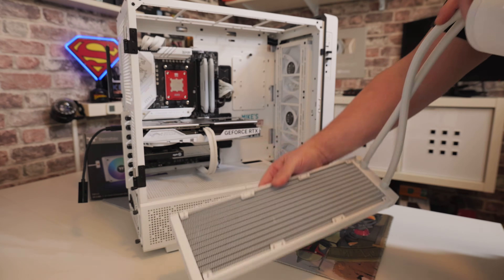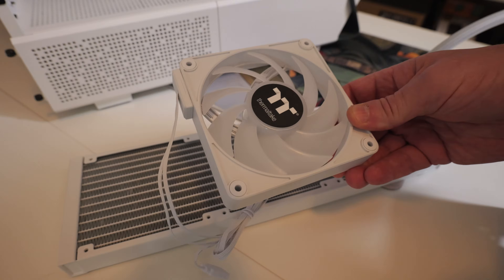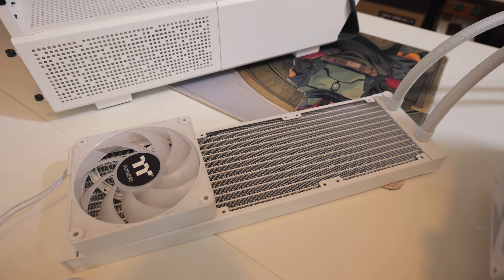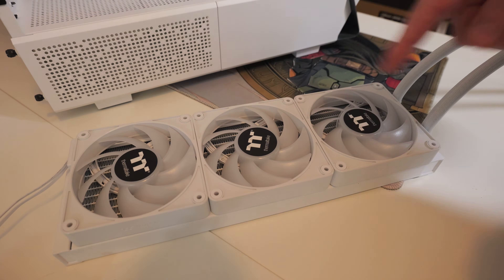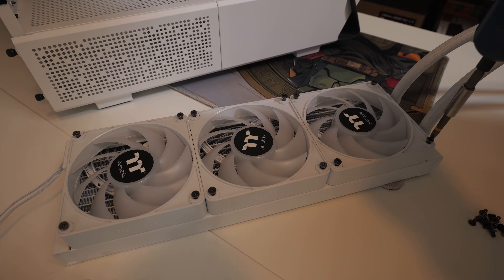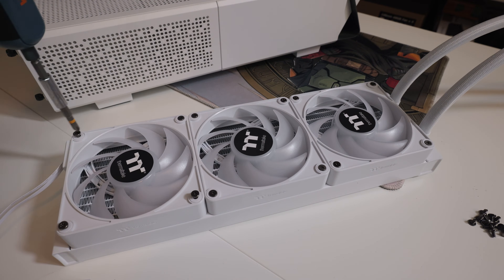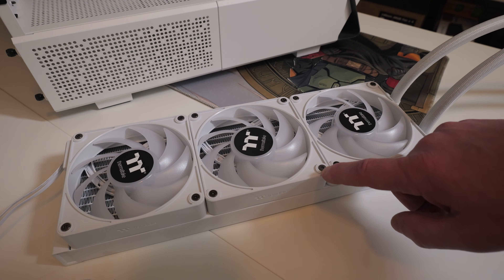We'll flip this upside down and put it on the desk, and we are going to be starting from this end for connectivity. Thinking about where our fans are going to go, get the magnetic connection on the end, leave that in place and that gives you an idea of where you need to lay the fans. They're just magnetic so they can all magnetize together approximately in place, and then we put the screws down through to secure the fans to the radiator. You can use an electronic screwdriver to speed up the process. With the screws, don't over-tighten them — just do it so that it snugs up to the plastic or rubber grommets.